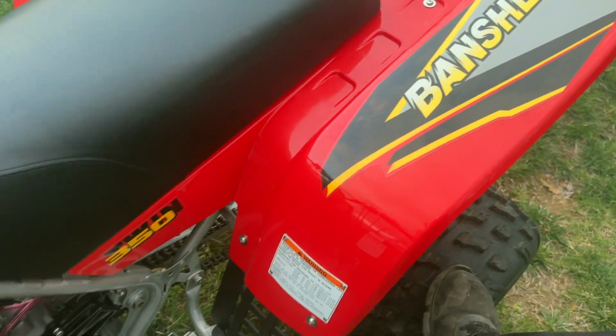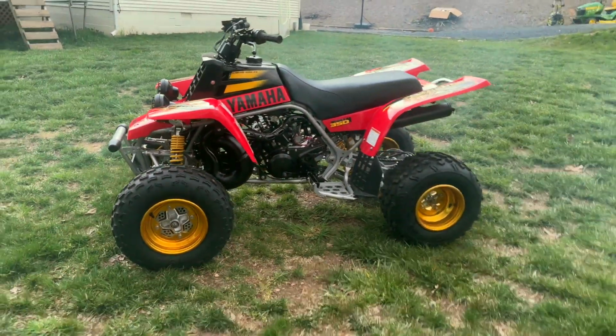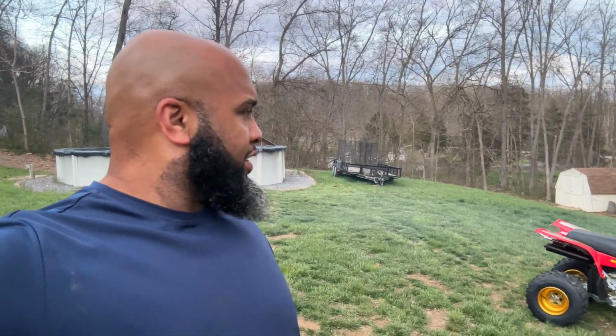Once you squeeze it, it doesn't want to move. It's set already for like 4 days with no gas leakage, so we're good there. I like to make sure when I'm doing these things. One guy did get a leak on one of the machines, but usually it's nothing much, just a couple taps to get them to seal up. I know when transporting them, if you transport them with the fuel off, the bowls dry out and then they bounce, and sometimes that gets the bowls out of calibration. They're not adjusted correctly, and then you'll have leaks and stuff like that.